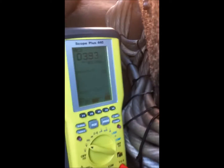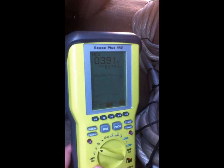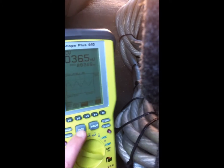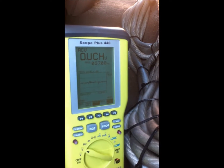You just hook the leads up to one of the sub outputs coming off of the deck. I chose the right RCA jack and connected the two parts of the probe. You connect the negative to the barrel of the jack and the positive to the center probe of the RCA jack. Set your O-scope to AC voltage and auto, and make sure that your F3 and your F5 are selected. F5 is your auto range and F3 is your frequency selection.